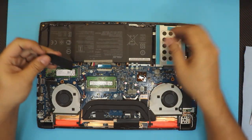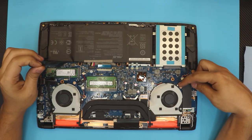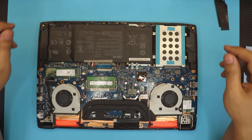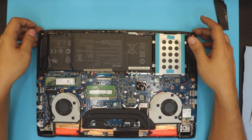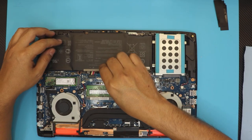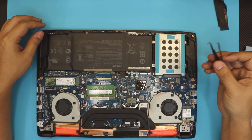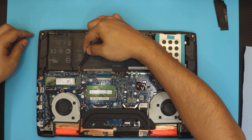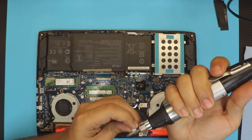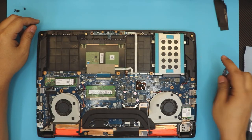Let's put the bottom cover to the side. This cover goes over the NVMe hard drive. There's one piece right over here too — you can pull them apart or put them back in the middle. First thing, I'm going to go straight to the keyboard, so we want to remove the battery first. Unlock the battery and unhook it — just put the tweezers right underneath and lift it up. Then remove the four screws in front of the battery.